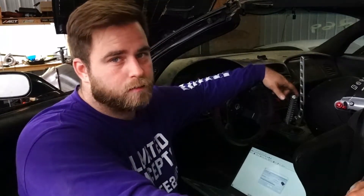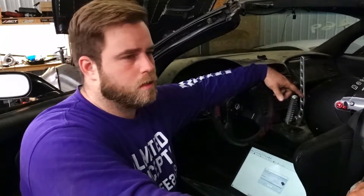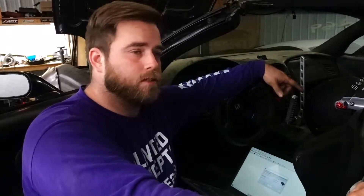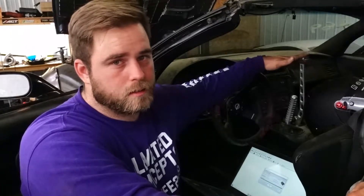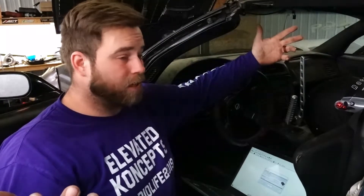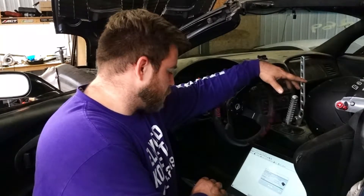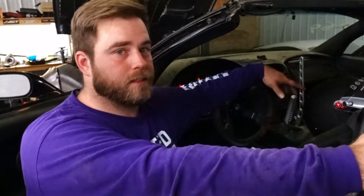It's ready. I really think that the fan is just bad — we're going out on a limb with the whole possible software fault. I think the fan is actually blown because the other fan comes on and we're using the same power source. The power source is supposed to power the fan but it's powering the relay, so it should work from the standpoint of electricity getting there. I don't think this software change is going to help anything, unfortunately, but it's worth a shot. I don't really want to have to swap my fans out, but I've got to have all my fans working. It says it's done writing, so I'm going to cycle the key, start it, and see what happens.